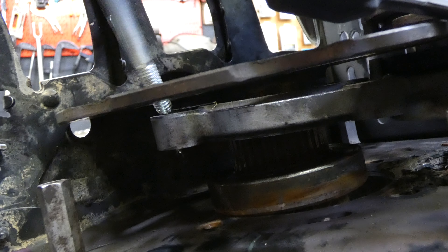Now just wiggle it around enough and the brake rotor comes out, then the caliper assembly is off and you just need to push it to the side. The only reason it doesn't move freely is because of the track, so you need to wiggle it, push it, and make sure the track is aligned straight. Then just pull up and out of the chain case — there's plenty of room up there at the top.